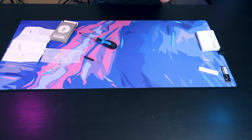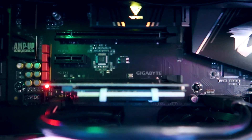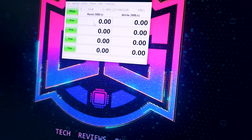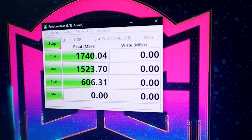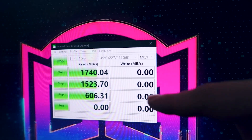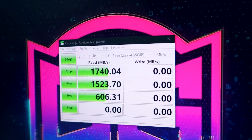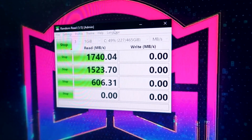Now we've got it all installed, we'll put it in the bottom PCIe slot and see what kind of speeds we get. It's clipped into the bottom slot — let's run the same tests in CrystalDiskMark: three tests, one gig, run all. We did take a little bit of a hit going from the top slot down to roughly an x8 lane, but still not a terrible hit considering it's in an adapter, not an actual M.2 slot — especially if you're just using it for mass storage.